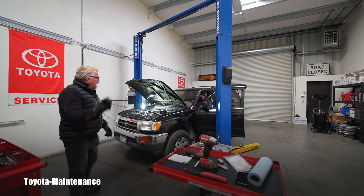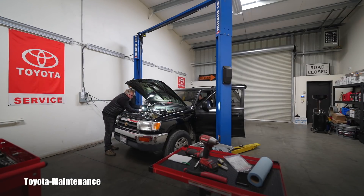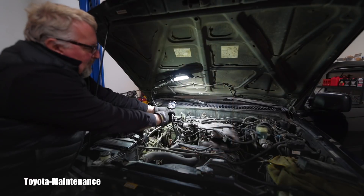I'll continue to number three so we're not jumping from one side of the engine to the other. I have it set - go ahead, Isaac. And we have 215 PSI in cylinder number three. I still love that.